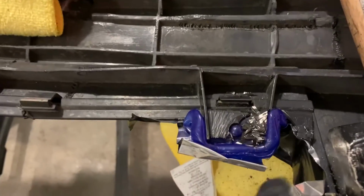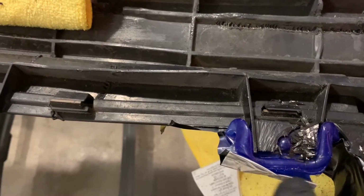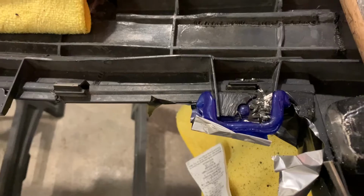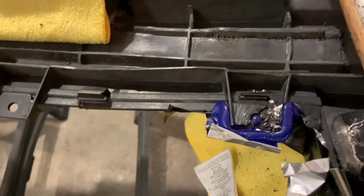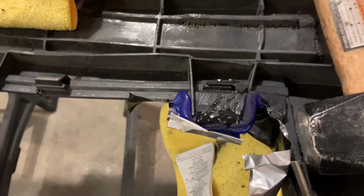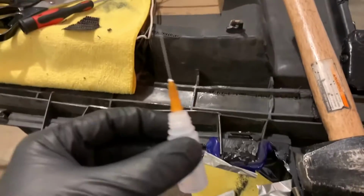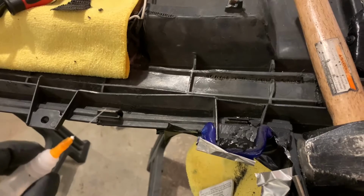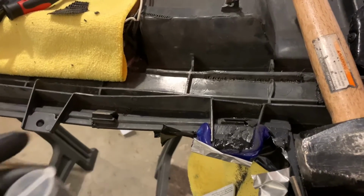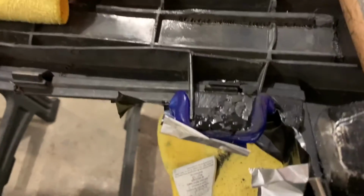I wanted to show you what I'm doing with this. I'm chopping up some carbon fiber, just loosely chopping it and getting some of the chunks in there, and then I'm going to put some powder on that, put a little bit more carbon fiber, and then saturate everything with fluid. In the instructions for the Polyvance Plastifix, it does state you can do reinforcement like this: you cover the fiber in the powder and then saturate it with the fluid. So here it is after saturating. I also used the drop and poke method with this little needle. You drip a drop into this little container of powder, then poke the drop, and that gets you a little spear of the powder that you drop in place. I did a little bit of that. Here it is. I'll pick it back up when this is cured.